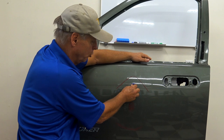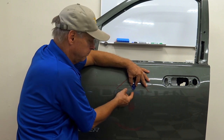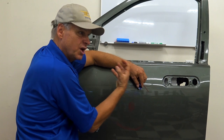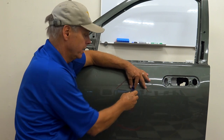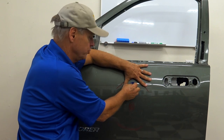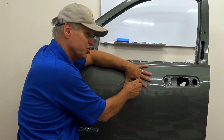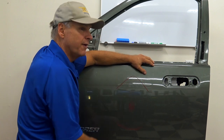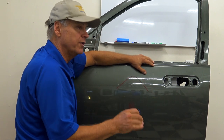But also, if you pull metal out from underneath that tab, so you're pulling and you see metal pulling underneath that tab, like a little bit of snot of metal, you stop immediately and you re-glue that tab closer to the apex. Yeah. Now you're just gonna pull, if that happens, you stop. Yeah, because your purpose is not to move metal, it's to get the crown energy to get back into that dent as fast as possible. So you get a much faster finish.